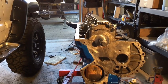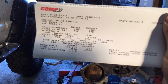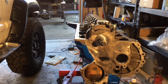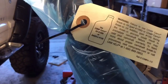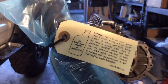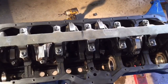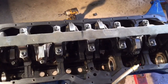All the oil pans should be good to go and now it's time to move on to the cam. This is the cam I'm using, that 68232 for, and on assembly they want you to use this lubricant that comes with it. I also bought a bottle of this from Summit. The tag on the cam says they want you to use their break-in oil or their additive — that's the oil we've been using to lube up the piston rings, so that's what we'll keep using. They want us to use the assembly lube on the lobes but on the bearing surfaces just regular old break-in oil.